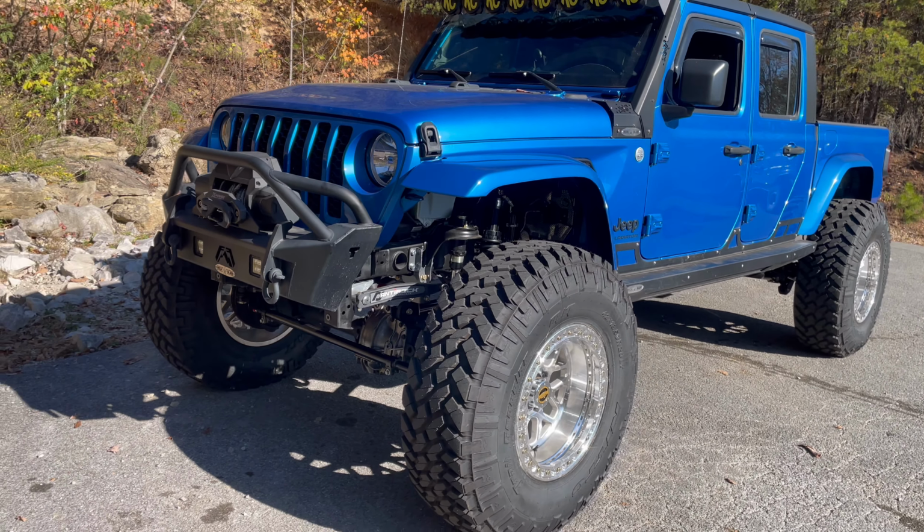We did do a battery auxiliary delete on this vehicle, and then also installed a tuner as well to correct all of the tire pressure, tire size, gear ratio things. Let's take a look here at how this coilover mount attaches to the top of the factory spring bucket, and then bridges over here and then attaches down here on the frame. We've got his ride height dialed in pretty good. It's sitting nice and level. And then of course the slider stops are where they need to be.